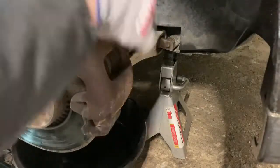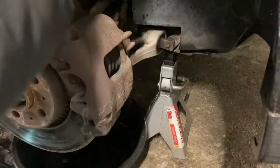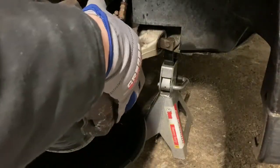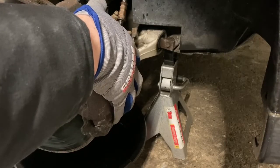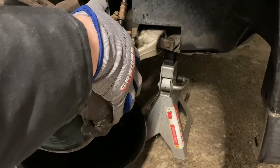When I took that brake hose off, I made a little plug for it - a little piece of rubber hose with a screw stuck in the end. That way it just blocks my brake line and all my fluid doesn't run out all over the place while I'm doing this, before I get the new hose on. You have to put the new hose in the caliper first and then screw it into the car.